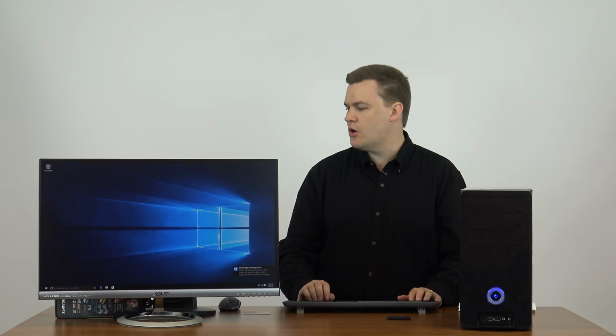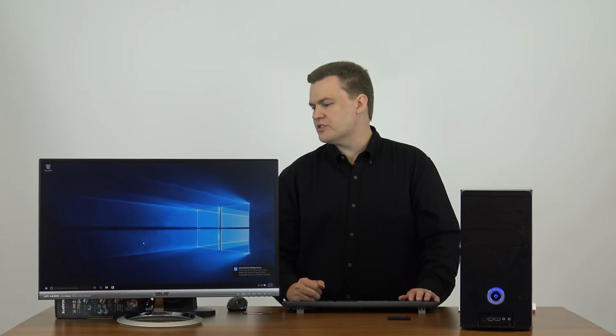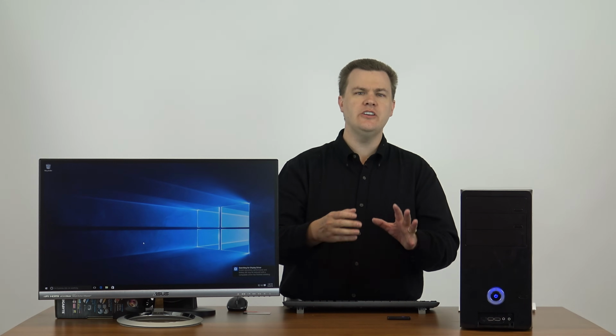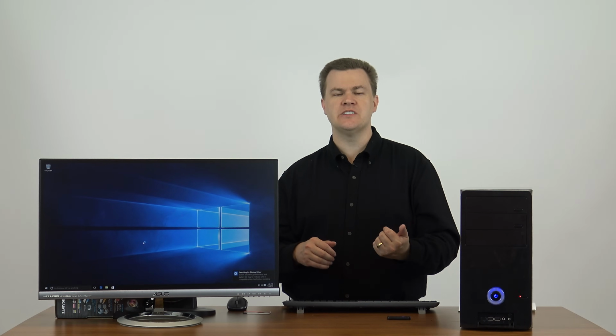You'll notice it says, let's start. We're already here. I love solid state drives. These things are so much faster. Now, it currently says in the bottom corner, searching for display driver. Understand this is a raw, plain install. When you buy a new machine, all the drivers and everything that you need are already provided by the manufacturer. Windows 10 includes most things you need. The single biggest thing that it doesn't include usually are display drivers, but it will pull a decent display driver off of Windows Update for you.